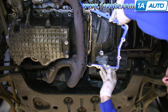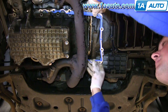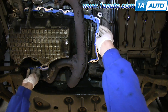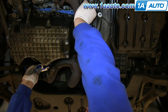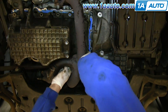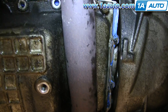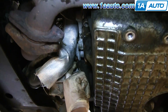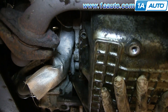From the driver's side, just feed that oil pan gasket back up into the oil pan and maneuver it back and forth along the sides until you can line it up properly. You can see — this is what it should look like. It should be on those studs right there. Then push the oil pan back up, making sure that the dipstick pushes back into place properly.